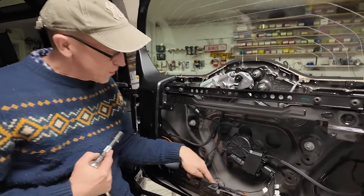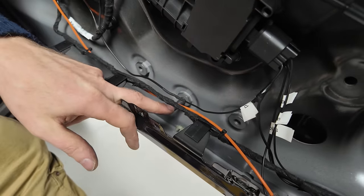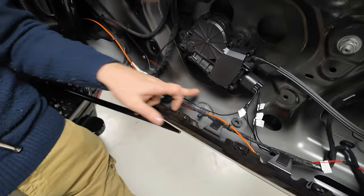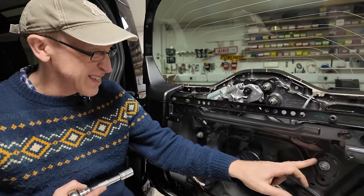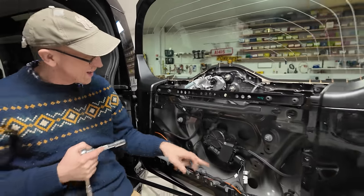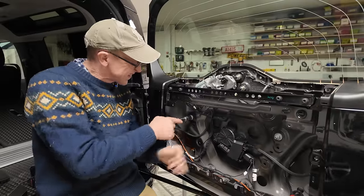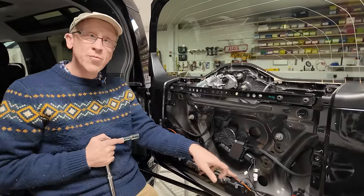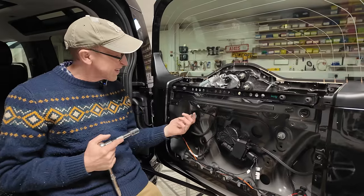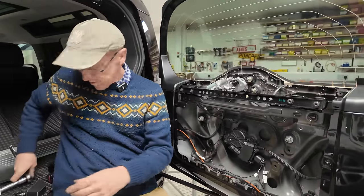You'll notice that we took the two bottom bolts out, they come through here. Now there is actually a sneaky third bolt hidden under that rubber stop. What I'm worried about is, as I hammer this, the only thing I'm reacting against is this bolt here and this bolt here. It may be worth leaving those bottom two in so I've got more to react against. But let's see how much knocking this takes to get off, shall we?